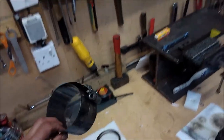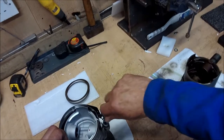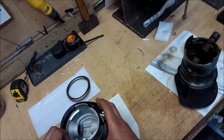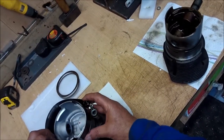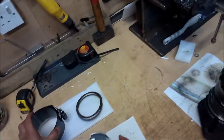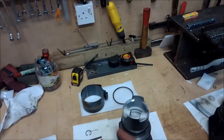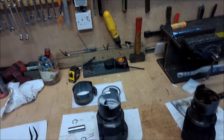Now that I've popped the piston out to check the rings, I'm going to have to use a ring compressor, which goes down like this and then winds up until it goes nice and tight. Then it's all lined up and a couple of little pats and down it goes — gently, not breaking the piston rings, obviously, because if you break one ring you've got to buy a set of four.